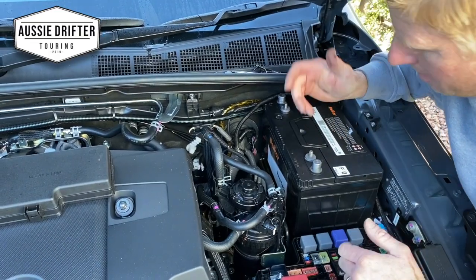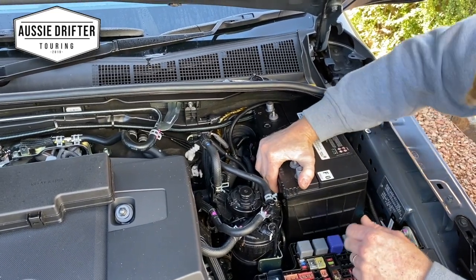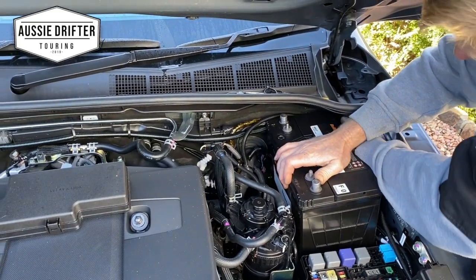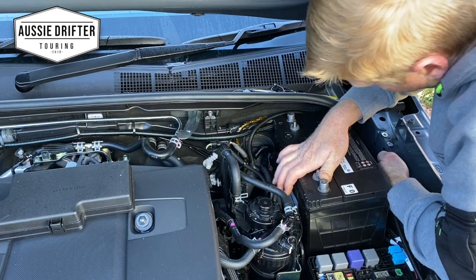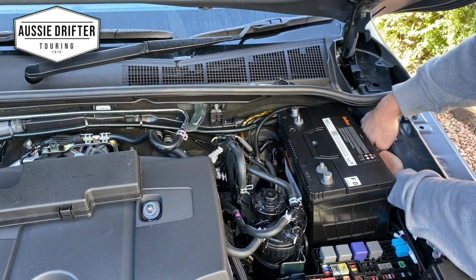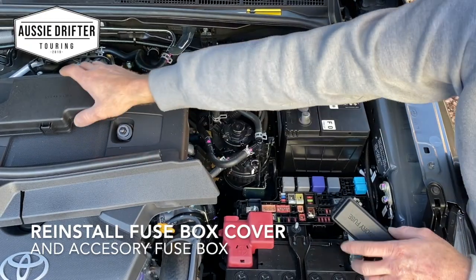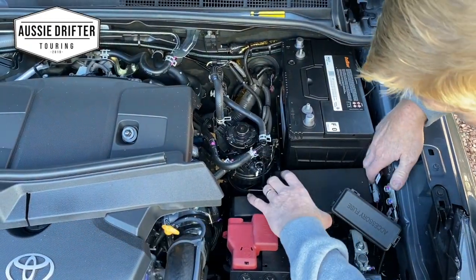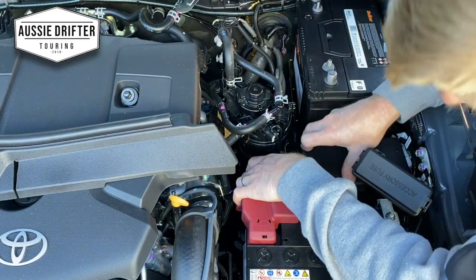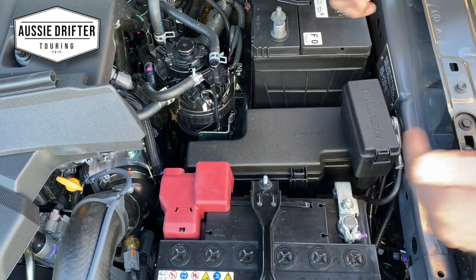Before we secure it, we want to get our cabling back and secured. While it's sitting in the tray, I can still rock the battery side to side, which gives me access to get cable ties in here. Make sure the harness is all sitting right and nothing can move. We can get the clip back in on the side of the body. Now that we've got our battery into position, we can go ahead and put the fuse holders back together — just the cover on the fuse box, then sitting the accessory fuse box back over the bracket so those tabs automatically clip in.